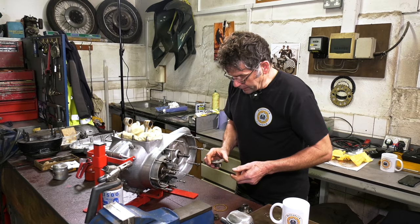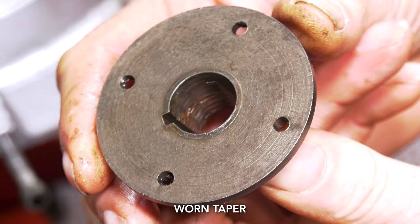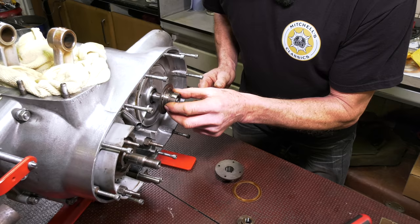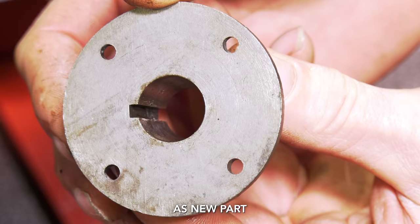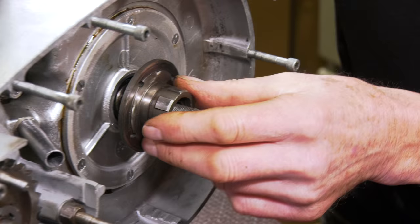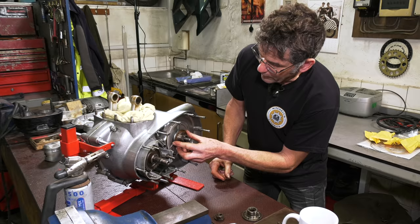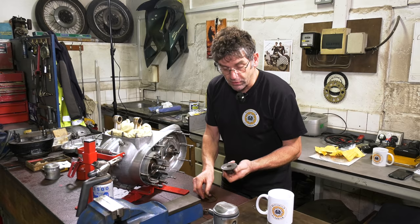Now the plate's back in place. We've just got to put on the main shaft clutch boss adapter. When I got this bike and went through the bits and pieces, I did find that the original taper is quite badly worn out — it's probably where the nut was loose and it's moved about on the shaft. Now if I put that back over the keyway, it doesn't hold on to the taper. I've been lucky enough to find a new clutch center, and when that's back on the keyway, it really is a good, nice tight fit. We can't put that on yet as we haven't got that far, but there has to be a thrust washer behind the back of the clutch.